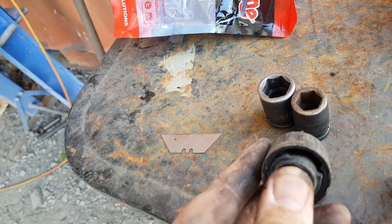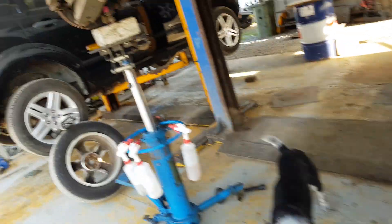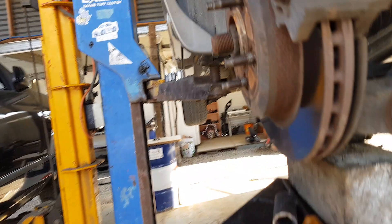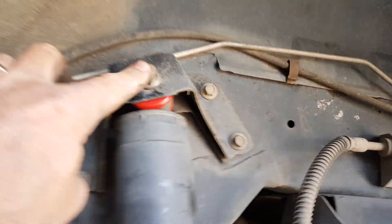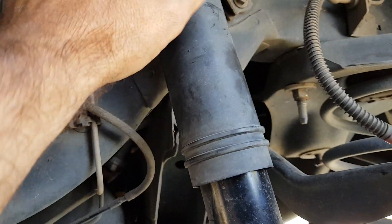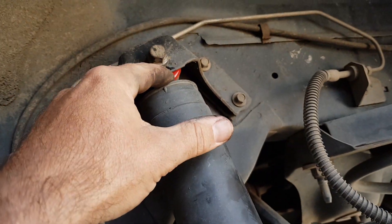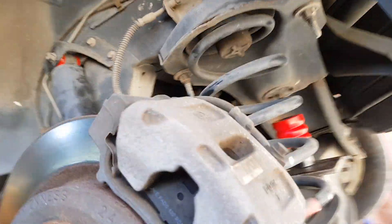It's quite loose there — not mounted solid. What it turned out to be in this case, and it often is the case, is the shock absorber bushes up the top. What you've got to do is just take the shocks out — they come in a pair — take them out, press those ones out that I just showed you, put the new ones in by hand, tap it back in, easy.